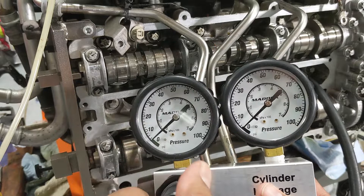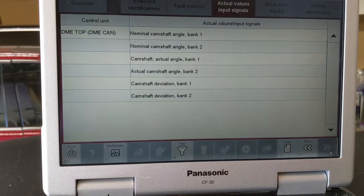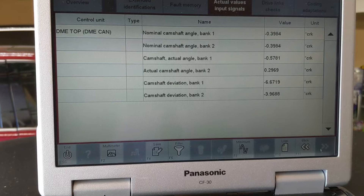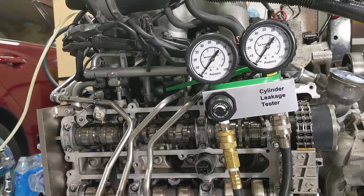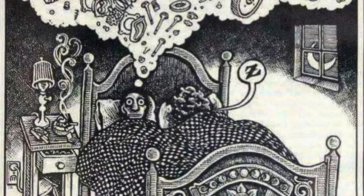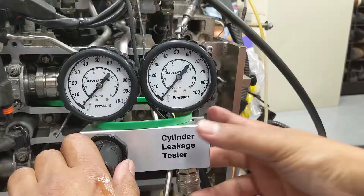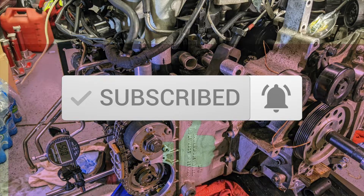Hey YouTube, thank you for watching Season 2, the final episode of this series on Jay's 997 turbo major engine-out repair. This video will cover the re-timing of the camshafts. He pinned the camshaft to prevent the sleeve from spinning out of position last time, but had a deviation of 3 and 6.75 degrees, which is acceptable but at the outer edge. He ran into issues with the timing chain coming off while rotating the crankshaft. It took him a long time to figure out the problem, so please like and subscribe. Big thanks to Jay for sharing and documenting this huge project.